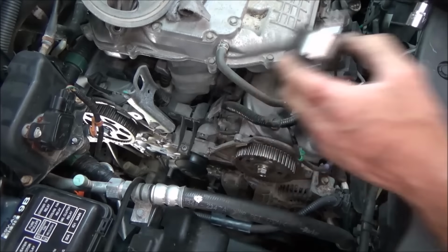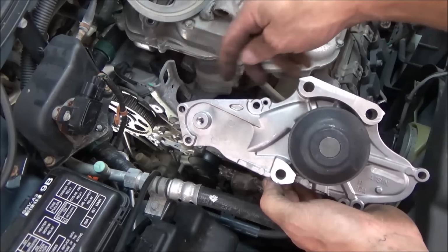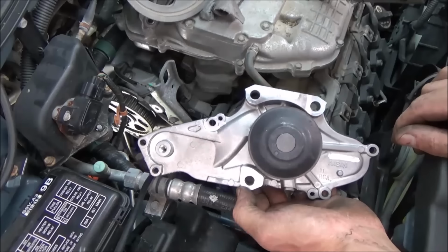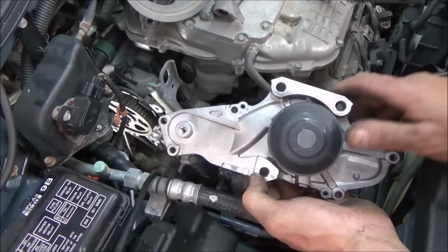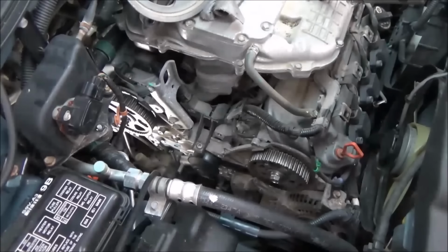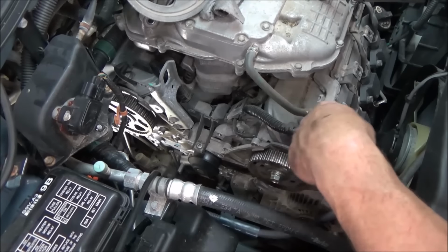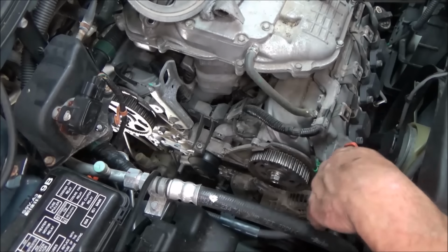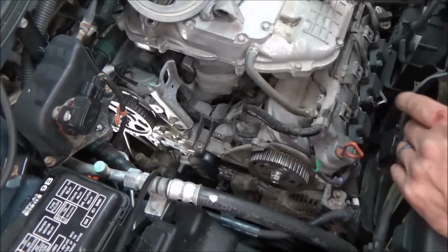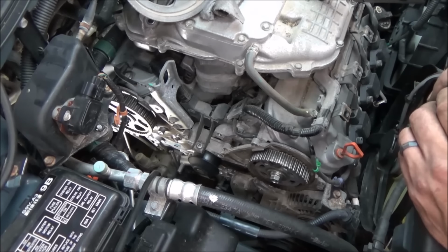Good old Loctite. Being that it's difficult to record, what we're going to be doing next is we're going to go down there with a 10mm air ratchet, and we're going to buzz the remaining bolts in the water pump off and get that out of the way. And like I said, it's tricky to record, so you really can't see, but just to give you a reference as to where we're at. And I guess I should mention one thing. I did not drain the radiator. You can choose to get a bucket and pull the petcock out of the radiator, or I've got a huge catch tray and real low profile bucket under the car right now. When I crack this loose, the antifreeze naturally will seek its own level and be drained. So either way works.